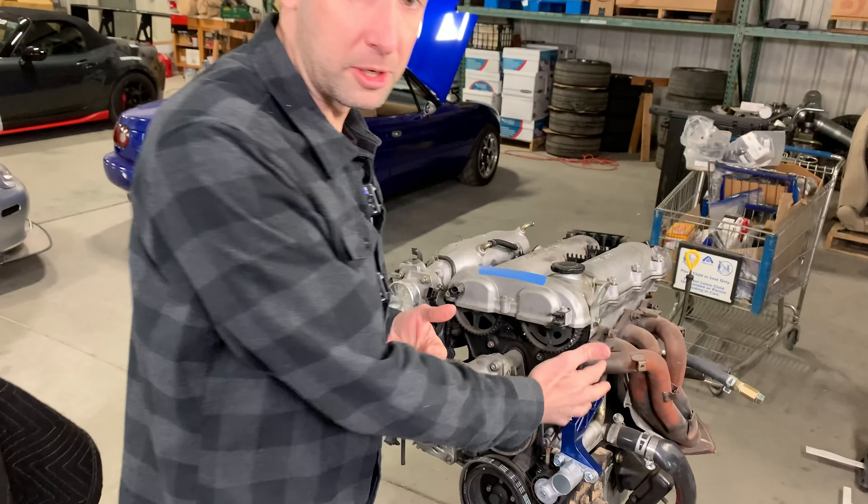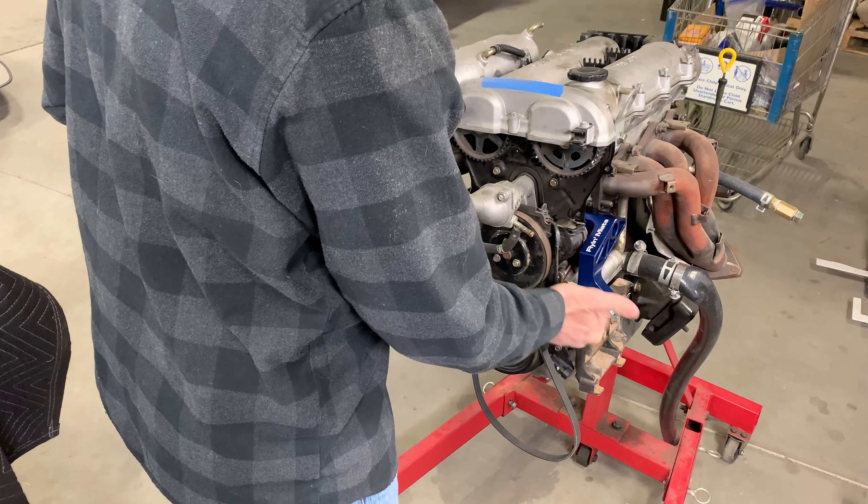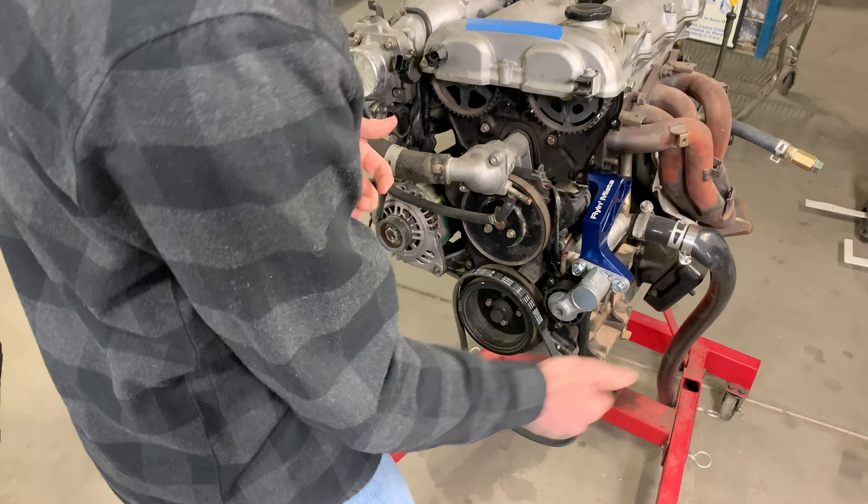Super easy install. You just remove the power steering pump, bolt the bracket to the block - uses all factory locations, of course. You bolt the pulley to the bracket, and let's imagine there's an AC compressor here. Then you put your belt on, and there you go. That's easy. Now the depowering of the rack is a different thing - this kit obviously doesn't have any of the components to do that. But as far as removing the pump but retaining the air conditioning compressor, it's pretty easy. We've had it running on a car for a couple of years and it's perfect.